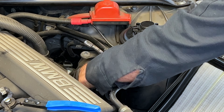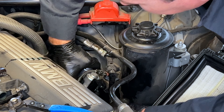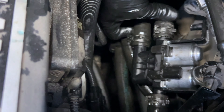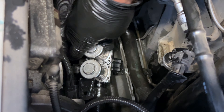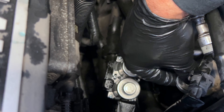There we go. Now to secure the clamps. I got all the hoses on here — the curved one goes there on the bottom; here's a picture for you for reference. If you look, it has a little hook right here at the bottom of this valve that's going to seat down in here — it's like a little grommet. The top two here are going to go in these top grommets, and it rests in there. Then we'll wash all this down with some fresh water so there's no residue left behind, and put everything back together.